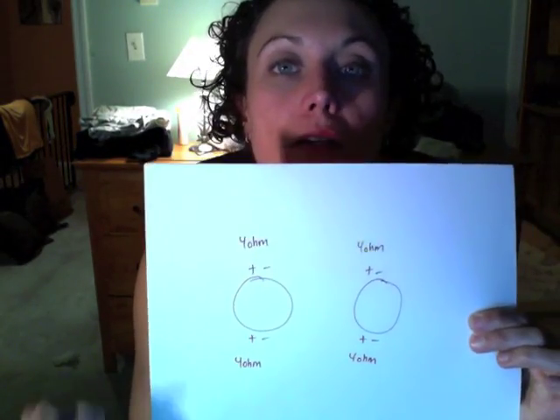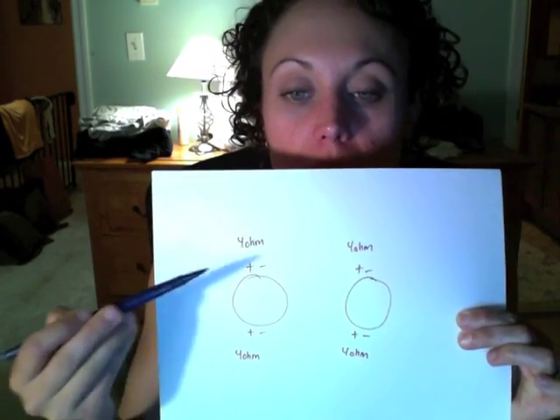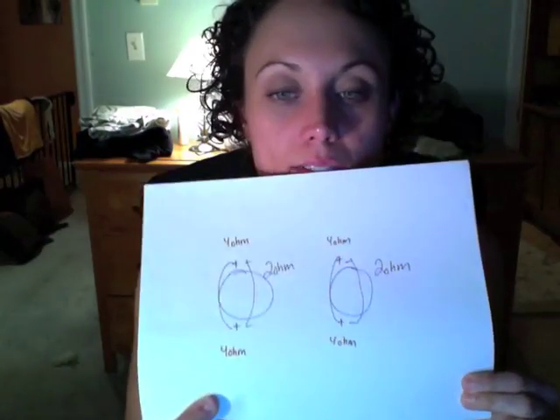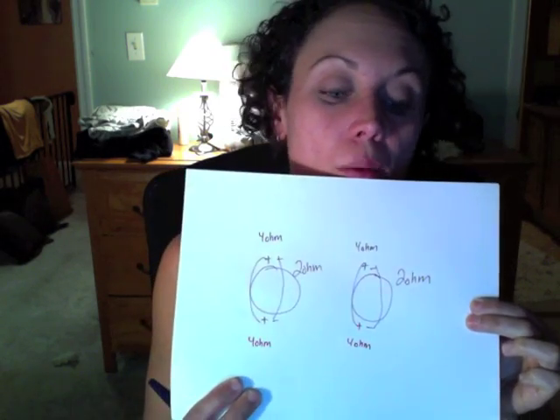Customers come in and get themselves two dual four-ohm subs, which means there are two positives and negatives on each subwoofer and they each have a rating. Most people think they'll just tie the positives together and tie the negatives together — that would be parallel. So now each sub is acting as two ohms each, which means the only safe thing they can do is series them so they act like four ohms. That usually sucks, because a lot of people end up getting subs that want a lot of power — like Pioneers or Alpine Type R's — which usually want about 600 watts each. Finding a mono amp that puts out the power you need for two of those, you're going to be in the $800 range.